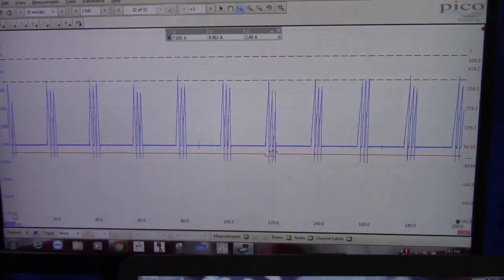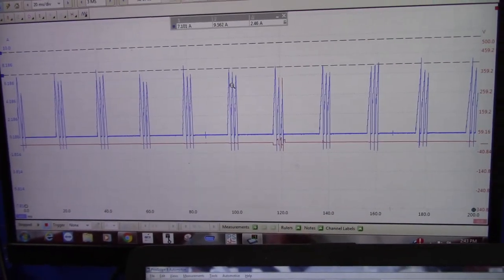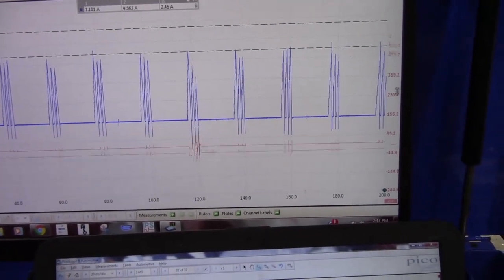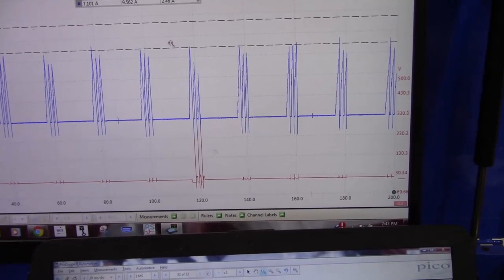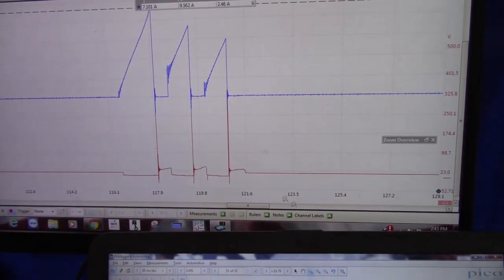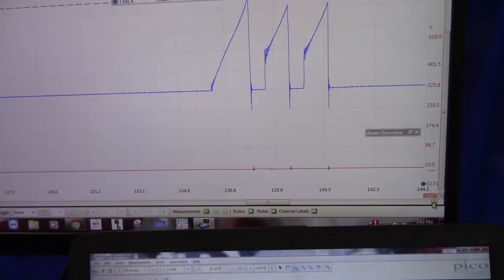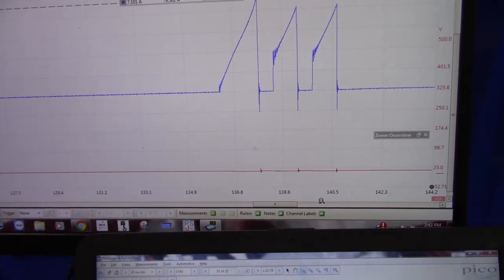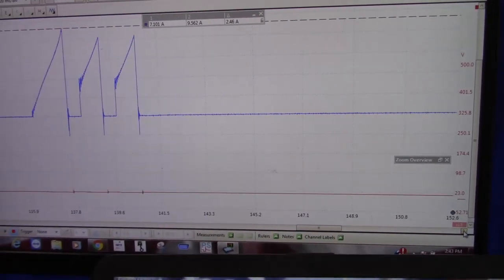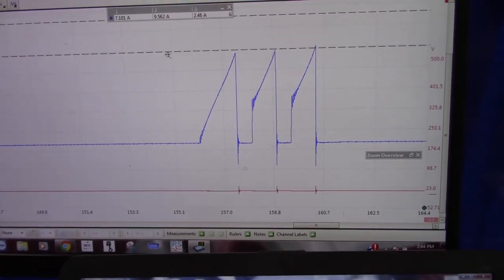All right, so before I was rudely interrupted, I'm back in here, and I'm going to show you again. We are synced on number 5. I got it right this time. Okay, this is our sync. This is our multi-strike ignition. We're going to scroll over. This is 4, and then we're at our problem cylinder, or what was our problem cylinder, number 8.